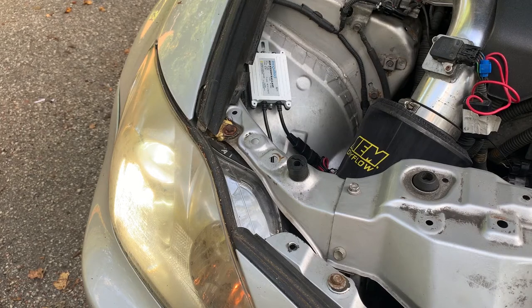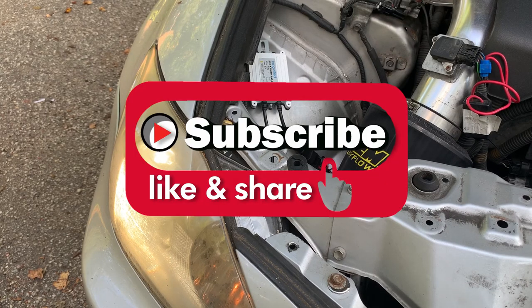That's pretty much a little tip on how to troubleshoot your HID bulbs. It is a different color bulb — I think it's like 6000K — and I believe what was in there was probably 8000K. Eventually I'll swap it out, but just to get me down the road this will do. Anyway guys, that's a tip for troubleshooting your HID headlight issues.